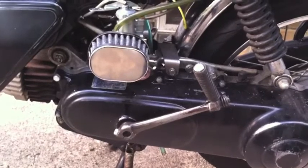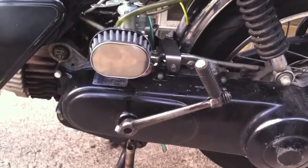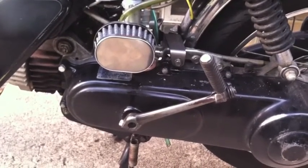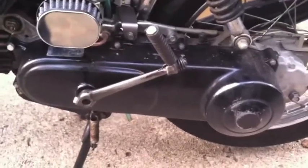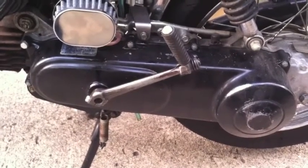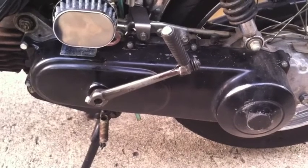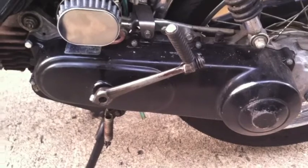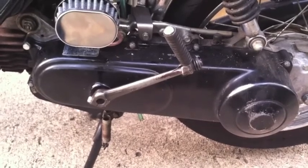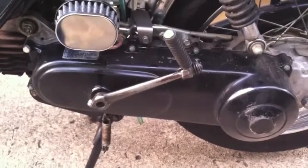Let's take it out for a ride and see if it's still four-stroking. It was four-stroking with the 75 jet, so we're down to a 70, which was what the carb came with. I think it came with a 30 idle and 70 main, and I've got a 25 idle and 70 main. I know I've got all these people whispering 'Urban Express, Urban Express — no more of these Yamaha QT50 townie video crap, we want to see the monster.' And really, this is the bike to get. I don't know why I messed with the QT50s and the townies and the Honda Express — Urban Express is the way to go.